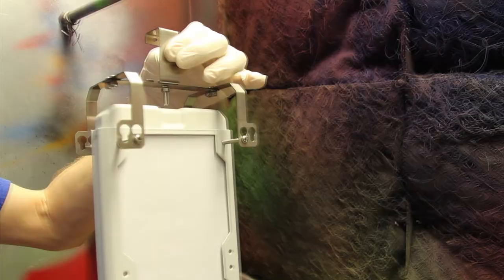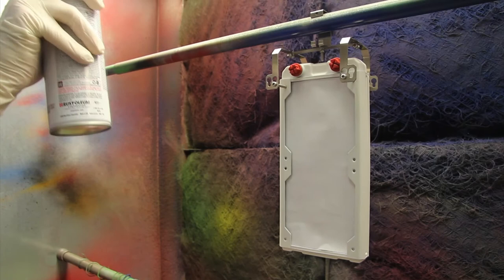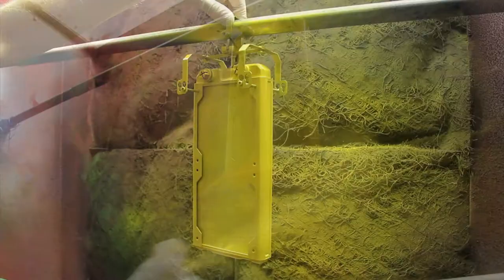After assembly of the rad hanger, slip the rad into it and hang for paint work — it's that simple. Follow the paint can's directions for use. Do not blob the paint on the radiator. You can flip the rad around on the hanger while still suspended to spray the other side of the rad for an even coat overall.